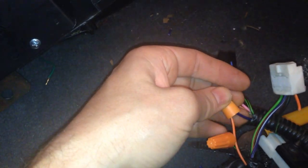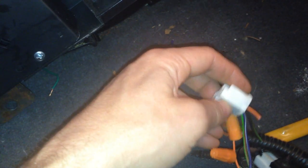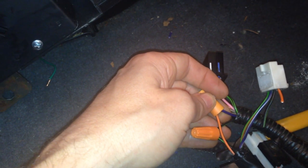The other option is there was a blue wire, which I've already pulled out. The blue wire is currently connected — right here you can see this end of the blue wire coming out of the wiring harness. I removed it from this connector and just connected it to the orange wire that goes to the seat belt. I also took the ground, which is the black and green wire right here. This blue wire only gets 12 volts if the ignition is on. So right now my seat belts are locked — no key in the ignition. Put the key in the ignition, turn it — seat belts are now unlocked.